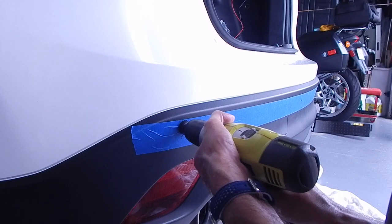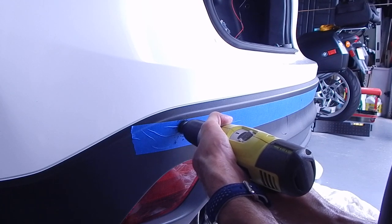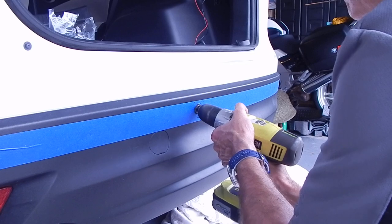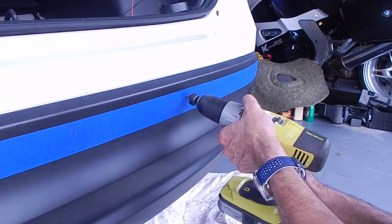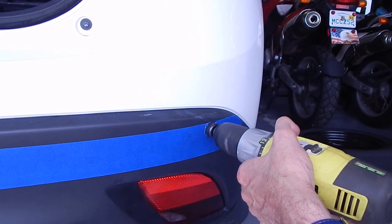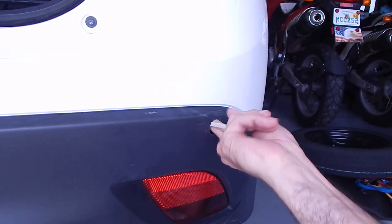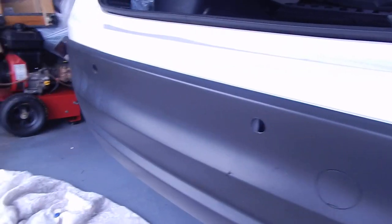Each of the connectors is clearly marked — the only ones that aren't different are the sensor connectors. Here you can see that after I've marked the bumper, I'm actually going to drill the four holes for the sensors. Take your time doing this — you don't want to be too aggressive with the bumper. Let the drill bit do a nice even cut so you have less cleanup work to do on any burrs. I'm going to sand down any burrs on the inside, then insert the wires and pull them through to mount the sensors.